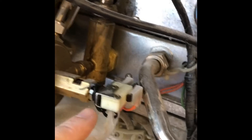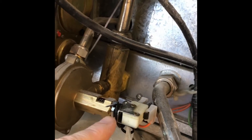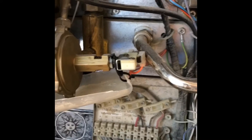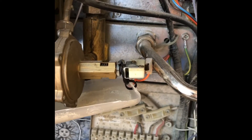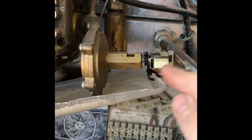If this is just slightly out of adjustment, if you turn the hot water tap off slowly it's too slow to react and the boiler continues to run. We find it worse - the worst thing is when you do the shower, which has got a thermostatic valve on it, and it's too slow sometimes for this to register.